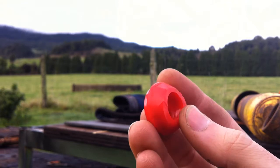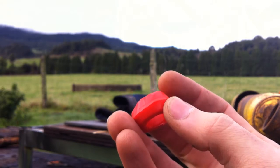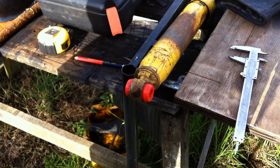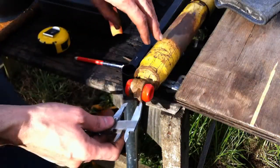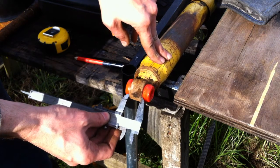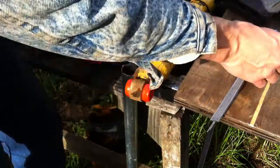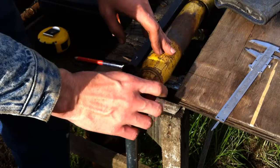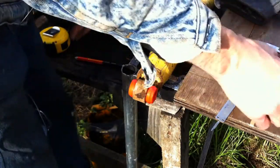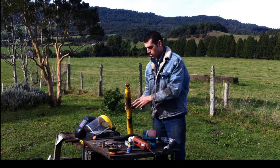I've got to make sure these fit well inside the end mounting point of the shock because when I put these in I noticed that they actually don't fit that well and they also have a tendency to spread out the mounting point width on the shock. So I'm going to make sure it's at the minimum width possible, then I'll measure it with the caliper from outside to outside, and then make sure I have a bung that works for that — I'll show you all that in a minute.